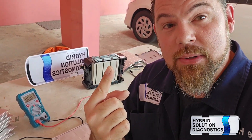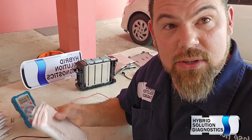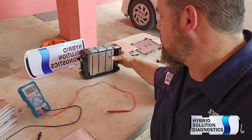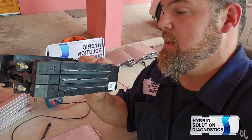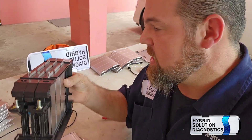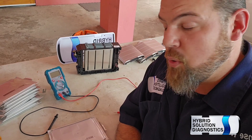It's not just one single cell that went bad in this unit. It's a complete structure that's probably degraded because of heat damage, and of course begins to swell the module. What's swelling inside the battery is gassing — that's actually what happens in these batteries. This is a very interesting heat exchanging system, but I consider that for hot weather it is super, super not efficient. That's my point of view of this integrated lithium-ion 12-volt battery from the IONIQ.